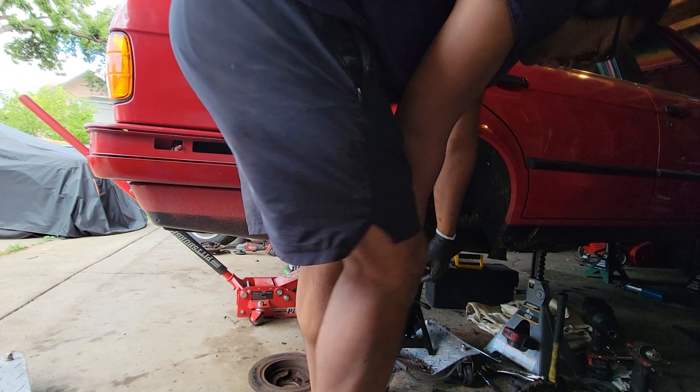All right, so we got everything out. We got the fuel tank — the paint has stripped where the brake fluid has contacted it. You can see it's supposed to be stainless steel, obviously not true. There's an issue right here on the seam, so we're going to try and clean it up — we'll do that on a separate day. We've got the subframe assembly out, and we've already dusted it with oven cleaner. That's the trick of the trade — don't inhale this stuff, by the way. We're going to take it to the car wash and spray it off, clean it up.